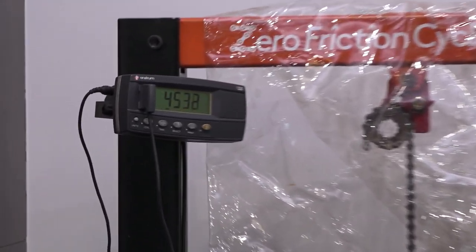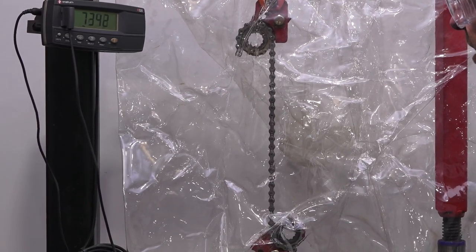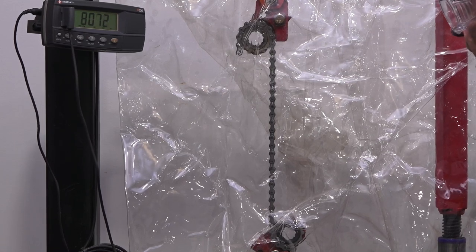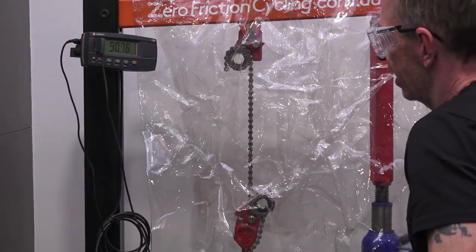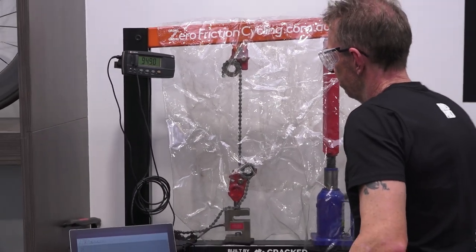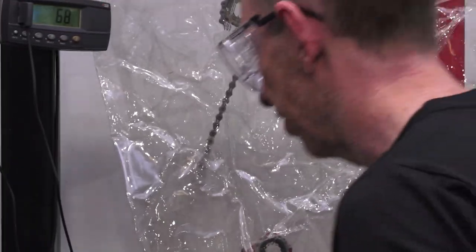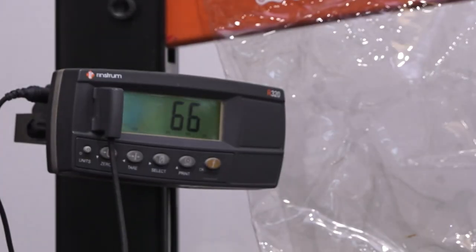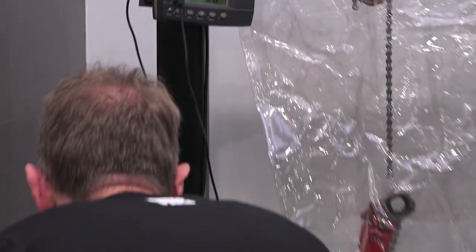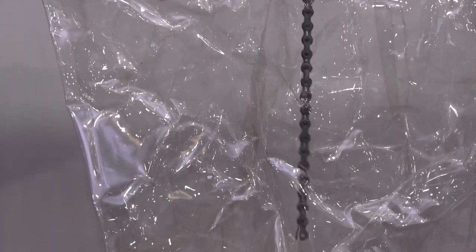3,000, 4,000 newtons, 5,000, 6,000, 7,000, so stretching, stretching, 8,000, 8.5, 9,000, 9.1, 9.3, 9.5, so 9.7, there we go, pretty much bang on 9.8, just hit stop there. Okay, so I'll save that. I'll be able to look that up, but I saw on the display that was basically bang on